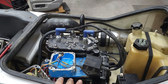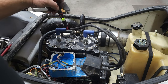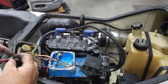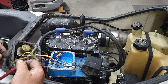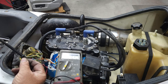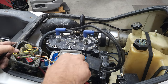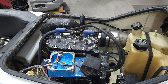We have it apart again. We're going to check for spark real fast — yep, spark's okay. The charge coil is usually what takes the beating, so let's do a resistance check on it. We're getting some resistance — that's a good sign. We're also getting solid AC voltage. It doesn't look like there was any permanent damage done. Looks like we might have caught it in time — that's positive.